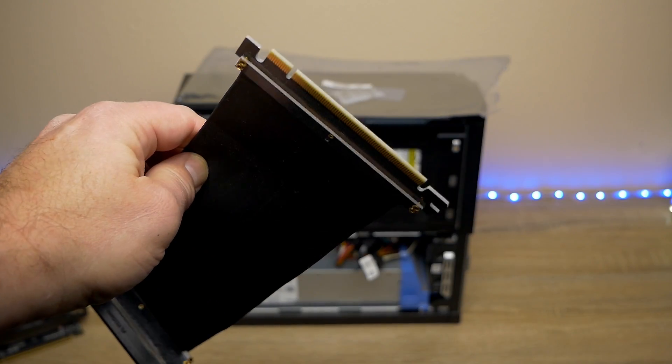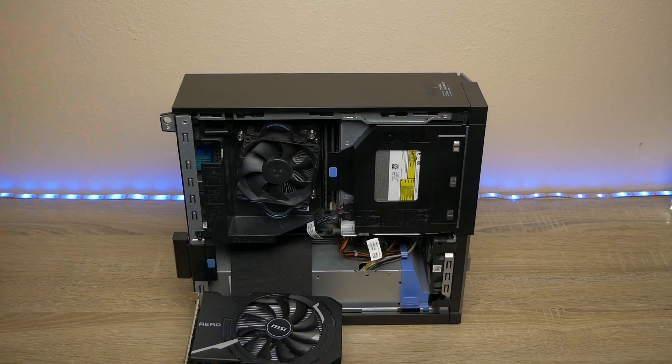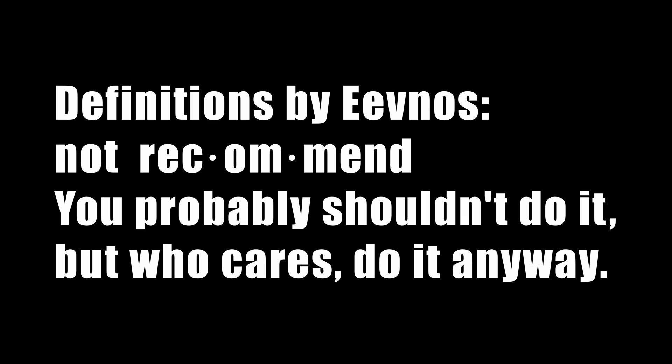Knowing I couldn't fit a card in there, I started thinking about other options and realized there's plenty of room for a ribbon cable. So I went on Amazon and looked for a PCIe riser. A PCIe riser is a ribbon cable with a male PCIe connection on one end that plugs into the slot on your motherboard and a female PCIe connection on the other end that the card goes into. I put my RX 560 card in there — no enclosure or anything — I just took a static bag, put it on top of the computer, and had the card laying right on top of that. I know PC build purists are going to freak out because this is not an optimal solution, and I would definitely not recommend anyone build this long term. I did this just as a trial to see if it would even work — and it does, little spoiler — but I would not recommend doing this long term.